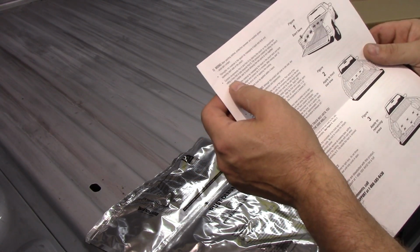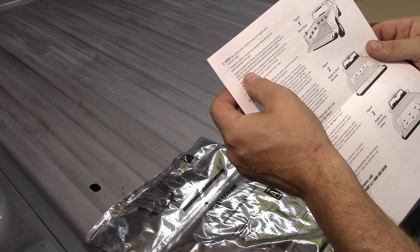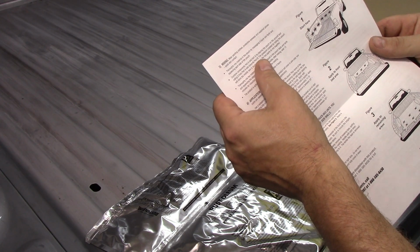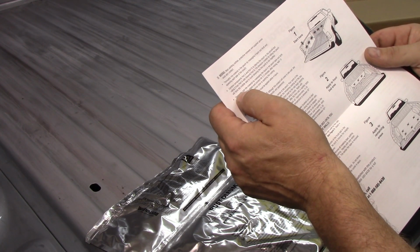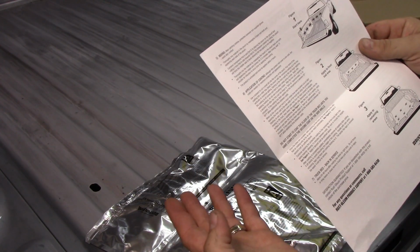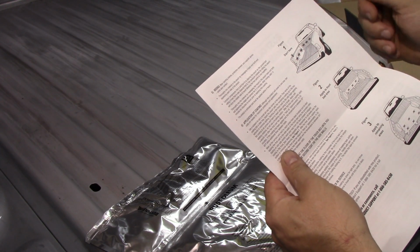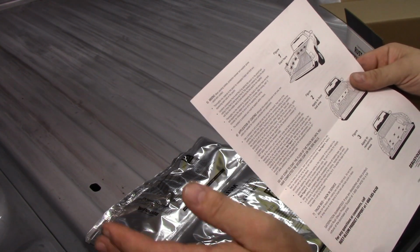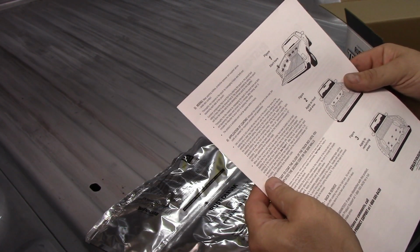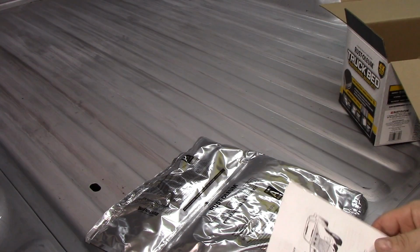Combine components part A and B by placing the pouch on the ground and rolling it from part A towards part B. The pressure created by rolling the pouch will force the middle seal to burst, allowing the 2 parts to mix together. Then thoroughly mix the material for 2 to 3 minutes, squeezing the edges and corners, after waiting 15 minutes for induction to occur prior to applying the coating. The product is activated and must be applied within 4 hours. So I hope I can get this done in 4 hours.